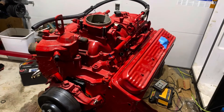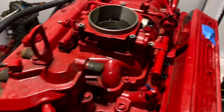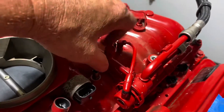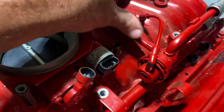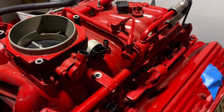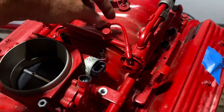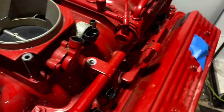The second way is you can increase the fuel pressure. The fuel pressure on this system runs about 43 to 45 PSI. There's a schrader valve on here where you can hook up a fuel pressure gauge when the engine is running. At idle, this uses what's called a vacuum reference pressure regulator — this hose connects to your intake manifold right there. The vacuum inside the engine lowers your fuel pressure down to about 39 PSI at idle.